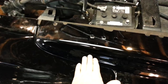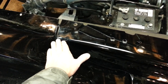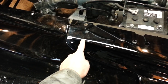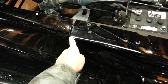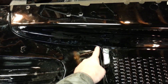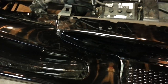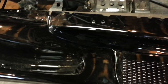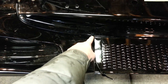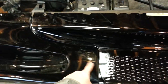To start, move your apron towards the front fender and get it close. Have somebody go underneath and match up the holes between the fender and the apron — get your bolt in there but don't tighten it up. Meanwhile, get your bead in there between the fenders, line it up, and then put the remaining bolts underneath. It's not going to be easy — you're going to have to force it a little bit. Work your way from the corner down to where the running board meets, then tighten everything up when it's lined up.